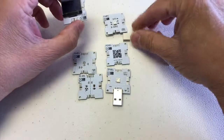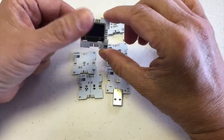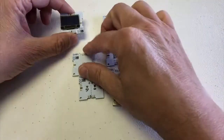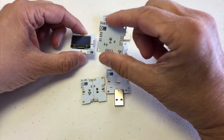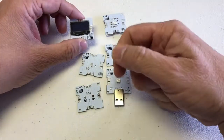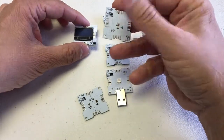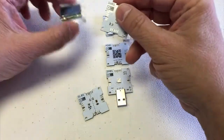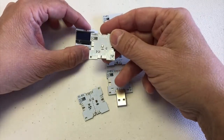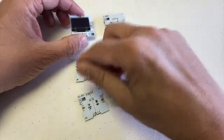So I'm going to take the display — and by the way, this is glass, probably the most vulnerable chip of all the X-chips. Don't press the glass; it might break. Hold on the side of the connectors of the X-chips — you can hold on the side of all X-chips, it's easier that way. For bigger assemblies you can also hold on the connectors between chips. It's very rare that you damage X-chips, but with all electronics, if you have a lot of static electricity that discharges through them, you can ruin the X-chips.